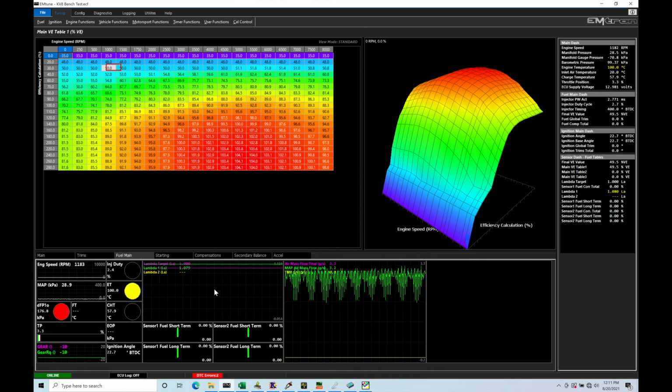We're going to be taking a look at setting up our traction control within our Emtron ECU. This tutorial is going to be focusing on wheel speed based traction control, where we can calculate a percentage of slip between the driven and undriven wheel speeds. This will signify if we have slip conditions or loss of traction, or if we're gaining traction as we're accelerating.